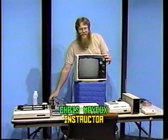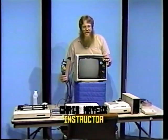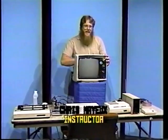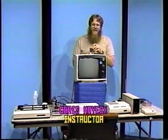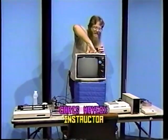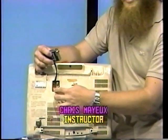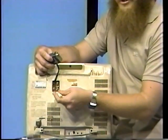A multi-outlet strip should be nearby to eliminate the need for an extension cord. It should be one of the surge and transient protection type, but it's not mandatory to be one of that type. First, locate the antenna switch box. Notice the ribbon type connector on the cable that is attached to it. Connect it to the VHF antenna leads on the back of the television using a small flathead screwdriver or some other similar device.